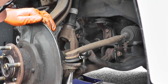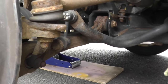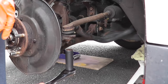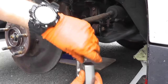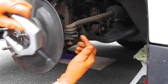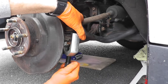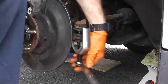Now we need to remove the steering tie rod — again, there's a cotter pin. But I've hit my first roadblock: the cotter pin completely snapped off on the front and on the back, so we'll need to drill this out. On the bottom here, this is a 17 millimeter. You can hit right here with a heavy hammer — you don't hit the tie rod itself, you want to hit the housing — or you can use one of these service tools. Just make sure you're careful with the boot.